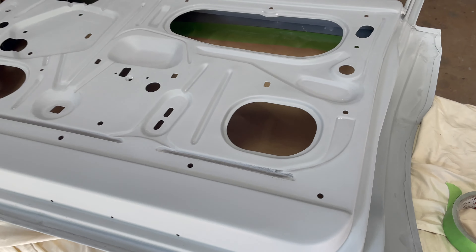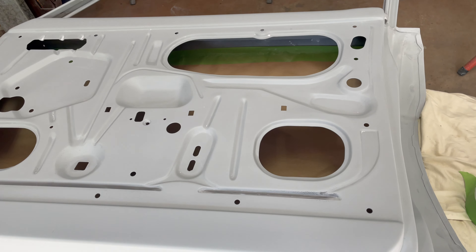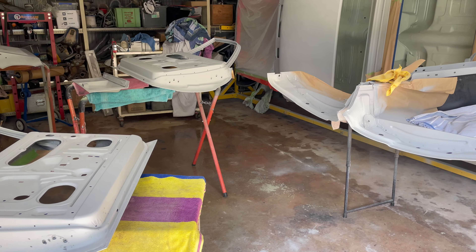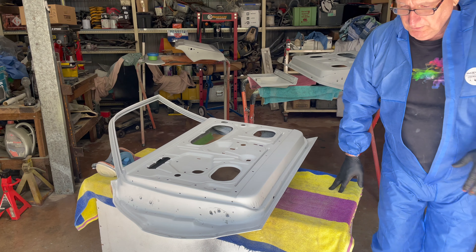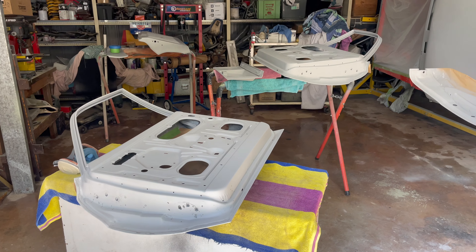At the risk of sounding pedantic, I've decided to mask inside the door — not because I'm worried about overspray but because I don't want any dust coming up. I'm sealing it underneath and masking around it so it'll be fine — just to prevent any nasty little surprises. What I've done here is wet the floor down. What I'm really trying to do is stack everything in my own favour — I've vacuumed twice. Fingers crossed, it's probably going to be okay.